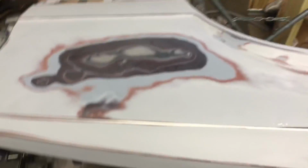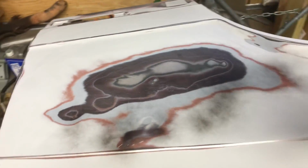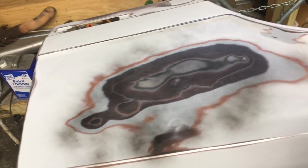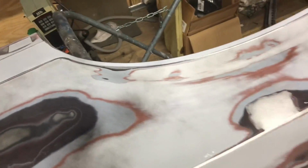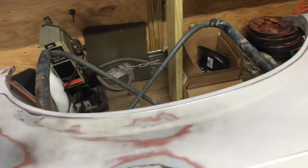In today's video, I'm taking care of a little body work that I done sanded down some rough spots, some cracks, and even some dents, and filled them up with some Bondo. Right now, you see us just spraying a light coat of some flat black across our areas to be able to identify our highs and lows to be able to get these spots perfected, guys.